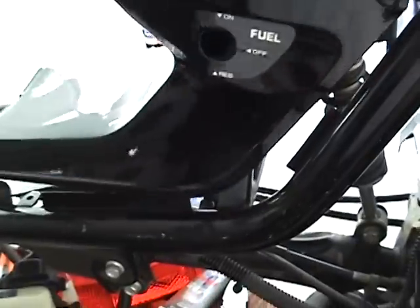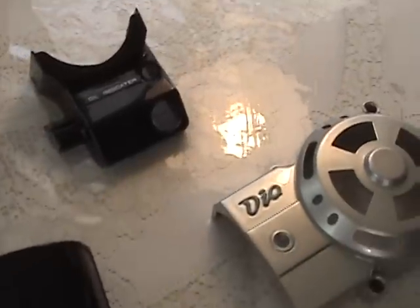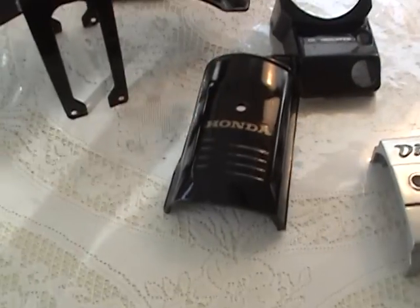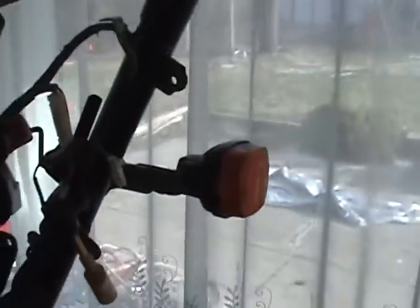Since I usually don't spray things with my guns that much anymore, now that I've gotten my first couple of coats on there, I kind of got a feel for it. I'll sand down half a coat, get it just a bit smooth, and put on probably another two coats, sand it down, then polish it — even the back piece and the tail light that goes up here. That's already done — I'm going to clean it up, put a little scuff on it and shoot it again.